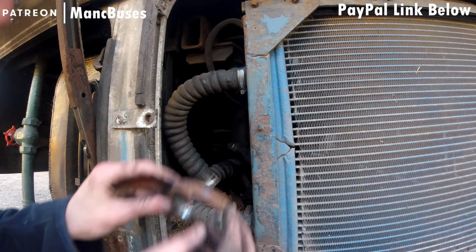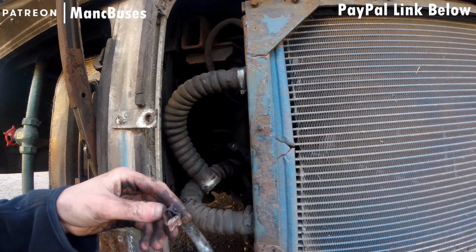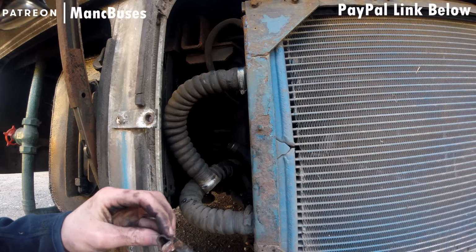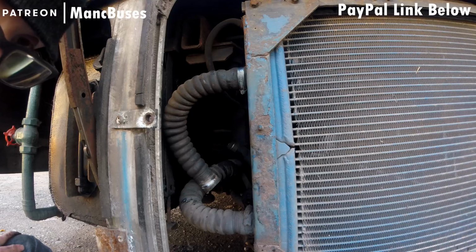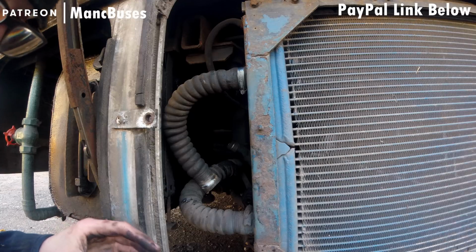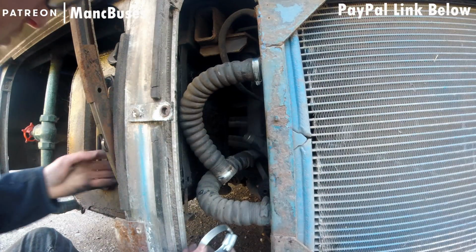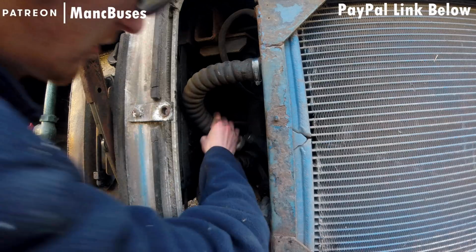Time now to put on the other hose clamp. Here you can see me trying to work out what size it was, because these pipes are slightly different from the rest. They allow a 33mm hose clamp, but it is snug, to say the least. I did also detect another leak in this process, but that I fixed quite quickly off camera. So this is the 33 hose, that's my hand. This is the 33 hose clamp piece that I had, that we bought from the shop.